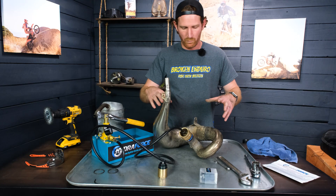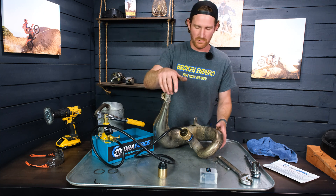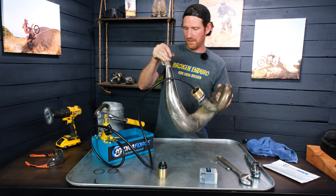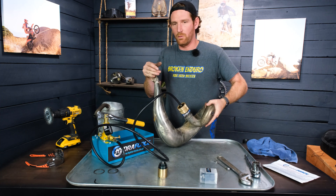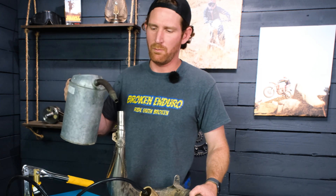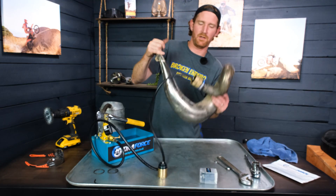I've got it mostly filled up with water, but there's this neck here where air can get trapped. You want to plug one end and get the air to the high point. Make sure there's no air moving around in there — twist it to where it's full, dump more water in, and just keep going at it until you're certain you've got all the air bubbles out.